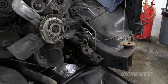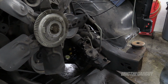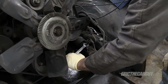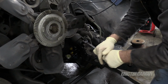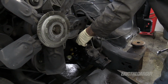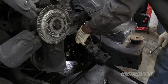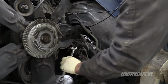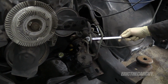Next, I am going to loosen the power steering lines off of the power steering box. My whole front accessory drive bit is going to be different. So this may change. I figure if I just disconnect down here at the steering box, ooh, things like this, like a rag joint like that, can also contribute to loose feeling steering.